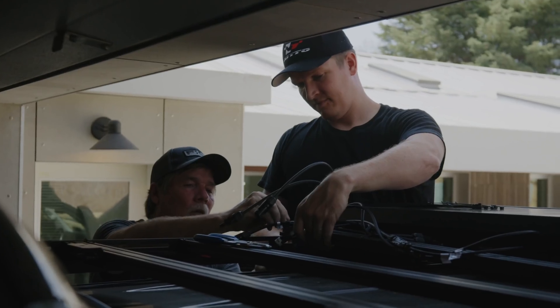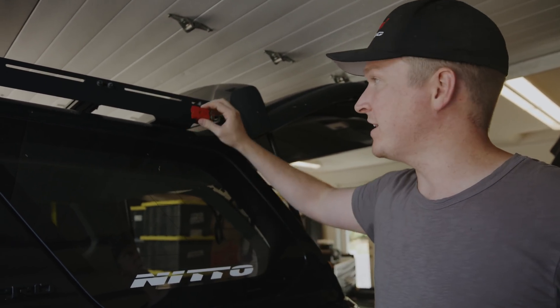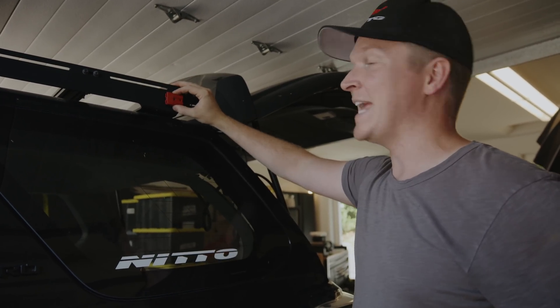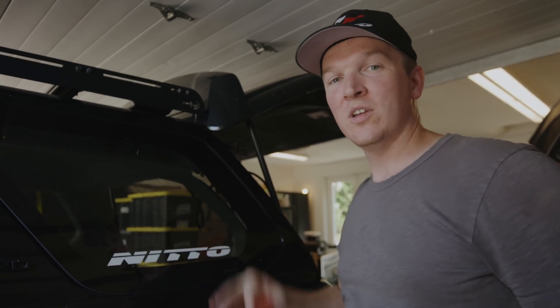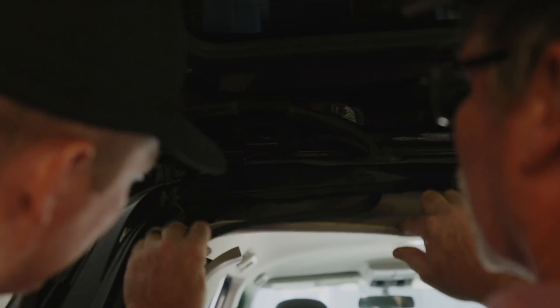We're mounting up our Anderson plug right now. The setup we've envisioned is to hide the Anderson plug on the inside of our roof rack — when we mount our four solar panels they're going to daisy chain and connect right into this Anderson plug. Once the panels are plugged in, we actually have the receiving plug hardwired directly into our solar charge controller. We drilled some eighth-inch holes into the side of the roof rack to mount the Anderson plug, then ran the 10-gauge wire through the existing weatherproof grommet in the back of the 4Runner, all the way down to the solar charge controller.